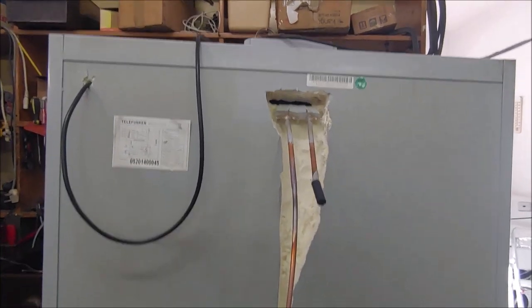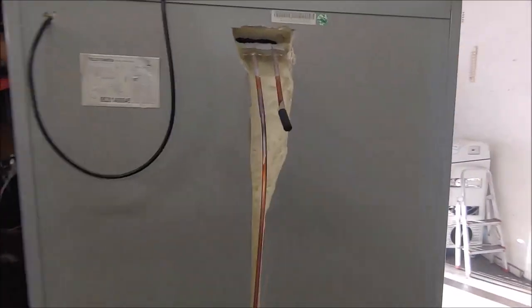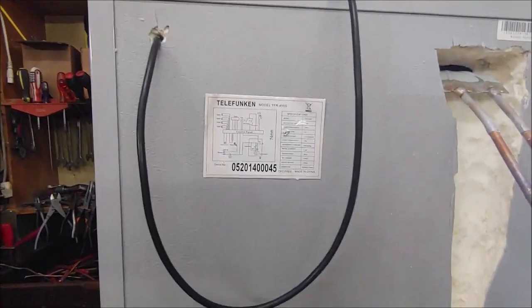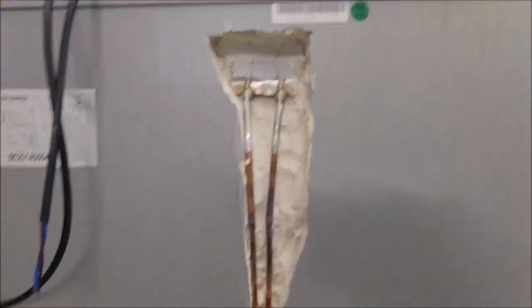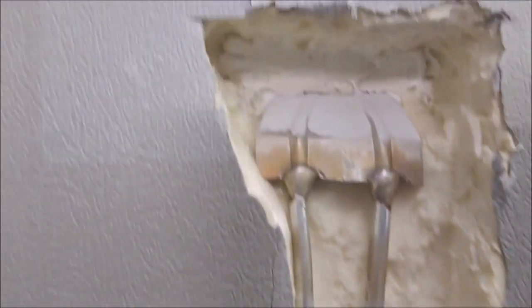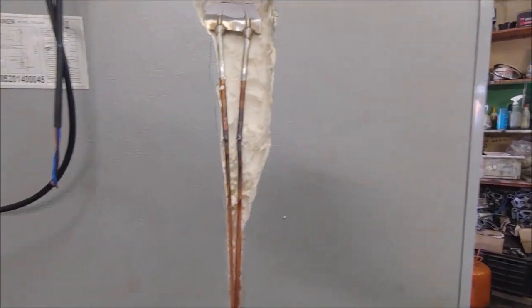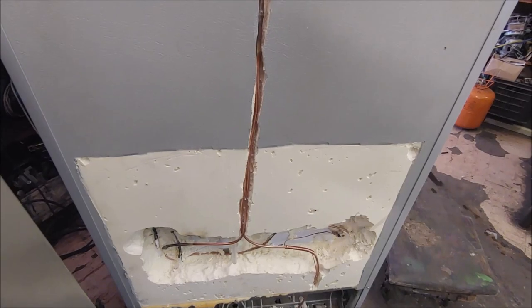Behind the fridge I've welded one pipe onto the pipe coming from the cold plate — I'll make that shorter and join it on here — and this one is your suction back down to the compressor. The wire from the thermostat comes through a little hole. I've put the pipes in running through this little slot, and the suction line comes out at the bottom through a little hole. I've wound the capillary around the suction line — for a very good reason. On the top I've put a little piece of styrofoam with some silicone and glued it in, because I'm going to lay the fridge on its face and fill all this up with polyfoam to insulate and seal it.